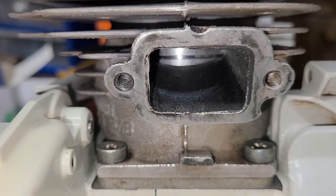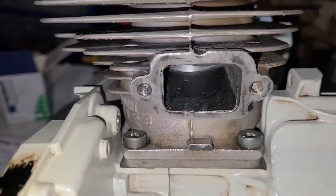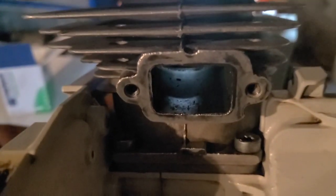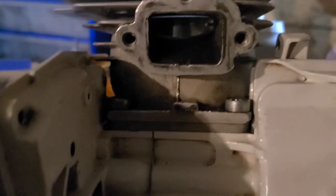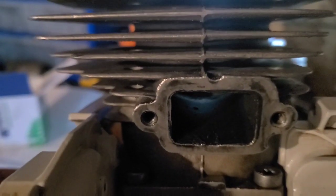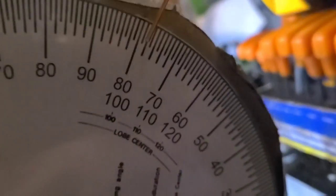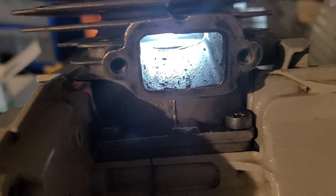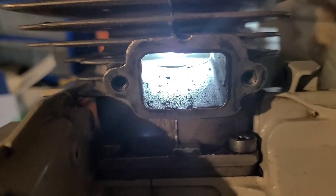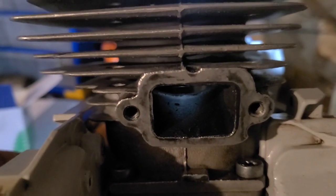There's where your exhaust cracks open. I'm going to pause it, turn the light off, and you can really see it. There's where the exhaust opens after top dead center — see, it's moving down. Right there. That is 102 degrees after top dead center.